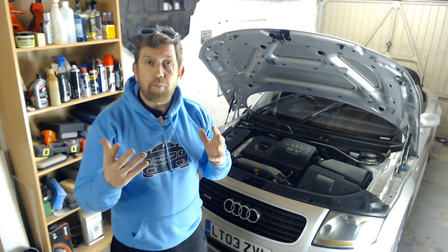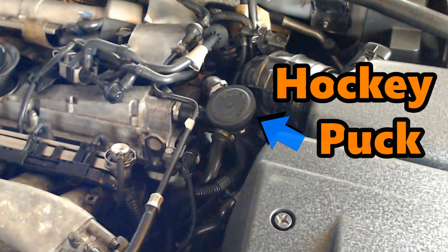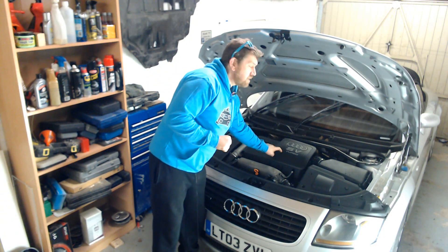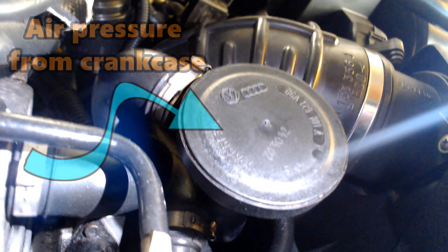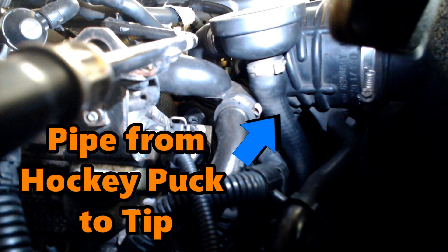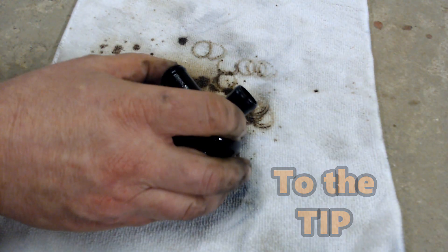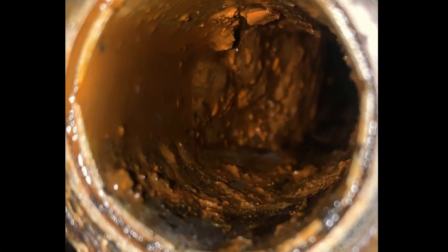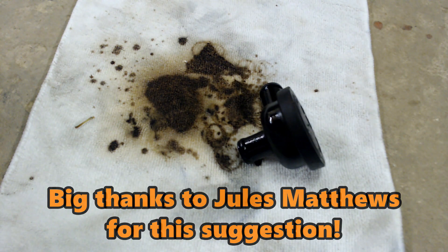As a general overview of the puck, it sits just about here under the plastic engine cover. The hockey puck plays a role in the PCV system by regulating the crank case pressure back into the tip — the long rubber tube that feeds air to the turbo from the air box. It also separates out the oil vapour somewhat and allows it to be burnt off. Some describe it as reducing or levelling the airflow pressure. Due to the nature of the puck and the oil vapour going through it, it tends to get gunked up full of goo and sludge over time, so taking it off and cleaning it out makes a lot of sense so it can perform at its optimum.